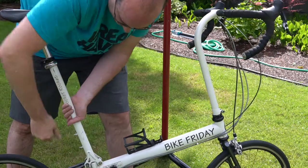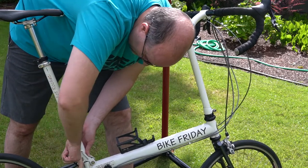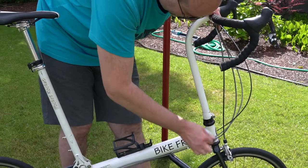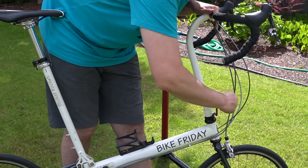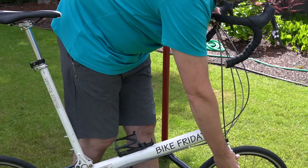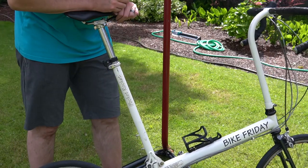Make sure it's fully seated — usually just put some weight on it — and then tighten this up, but not too tight because you'll break it; it's an aluminum bolt. Then orient this so that it's straight, make sure it's fully seated, and tighten this down. This one is steel so it is pretty sturdy and I tend to get it tight — I don't want it coming off on me; obviously if this comes off you're going to have a very very bad day. Then the last thing is just pick up the rear wheel and make sure the chain is back on and you're ready to roll.